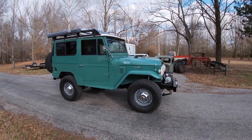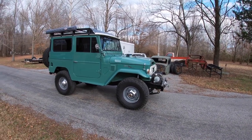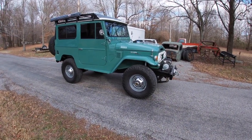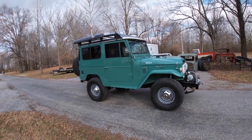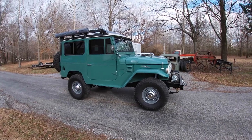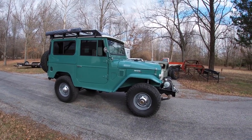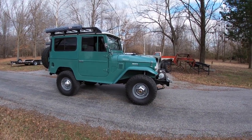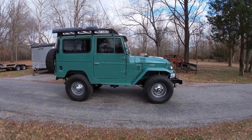They brought us a really, really good tub. Andy says it's one of the best bodies and frames he's ever come across — a really good chassis that they already had powder coated. They already rebuilt the axles, already had a fuel tank for it, and had already sourced the body. What we did was take a brand new GM Crate 495-horse LS3 and mate that to an early 2000s brand new GM NV4500 — the kind that came in a manual transmission gas three-quarter-ton truck, only made for a couple of years. Then Advanced Adapters adapted the correct Toyota transfer case.